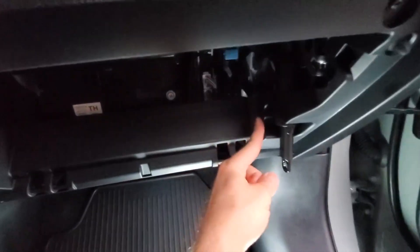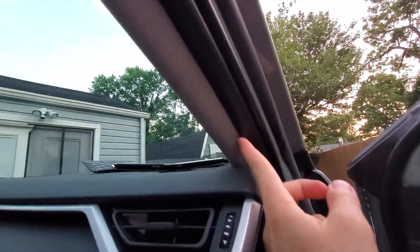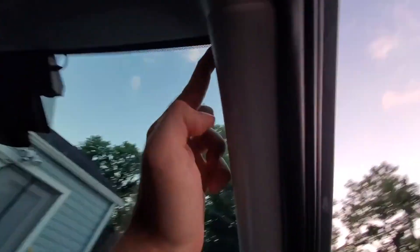You're going to send your wire here and then find it over here somewhere. Then push it behind this weatherstrip and then behind this one, just like I did on the other side. Go up and around the A-pillar, and then back over here.